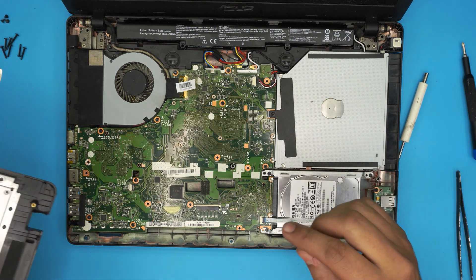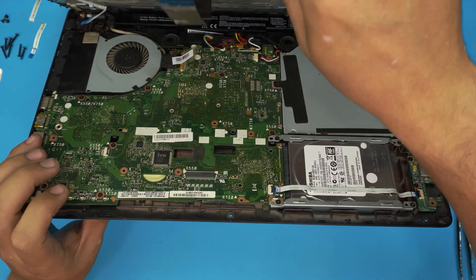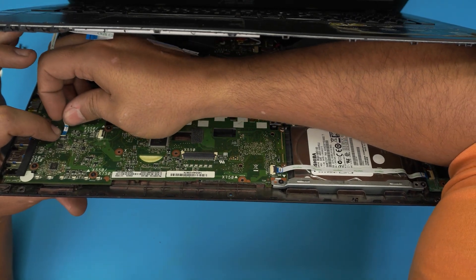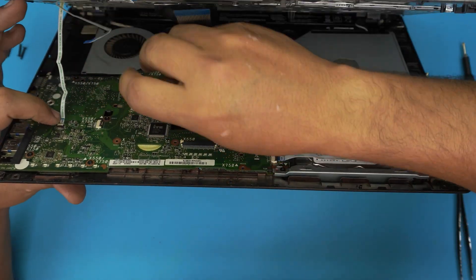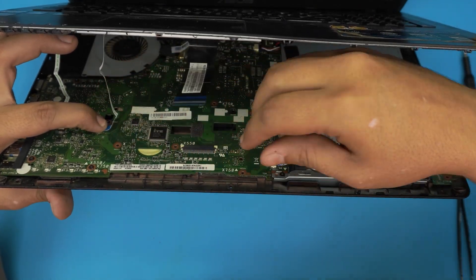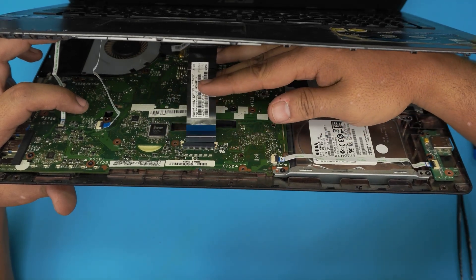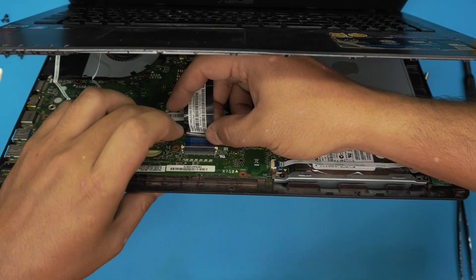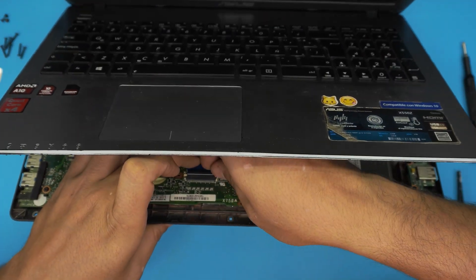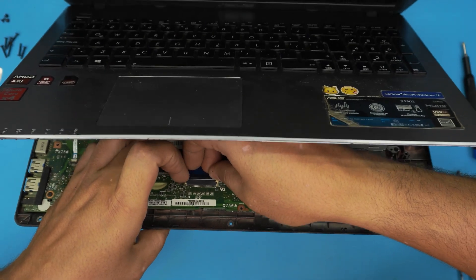Grab the palm rest, place the hinge side down with the hinges aligned, then close the laptop to about 45 degrees. Connect the on/off switch ribbon cable by sliding it under the jack and closing it. Open the touchpad ZIF lock, slide the cable in, and close it. For the keyboard, pull the two triggers backward toward the screen, slide the cable underneath, then push the locks back — make sure it goes in evenly. If it's not even, open and redo it.